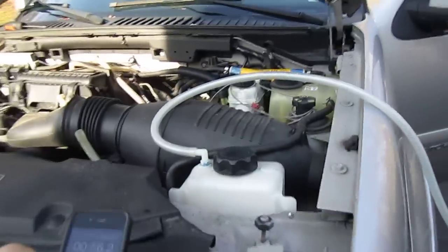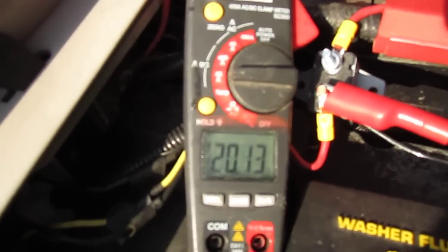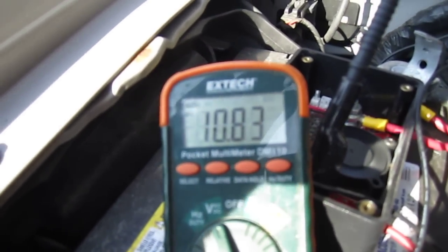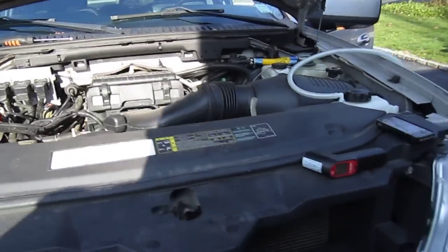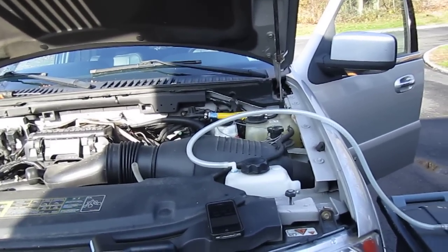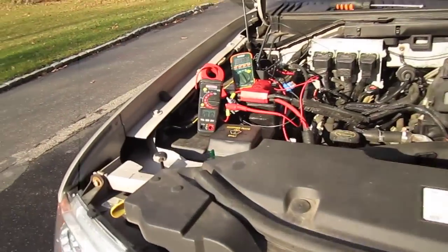So right now I'm going to go back and do another quick re-look. We're at 20 amps — it bounces back and forth a little bit. 10.83 volts. Generally, good cells with no hocus pocus — really good bench tests are running say 200 to 205 watts per liter. You're not going to find anything installed that touches this.